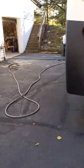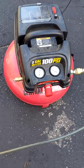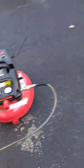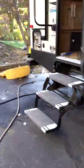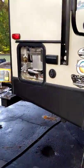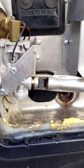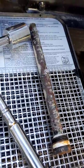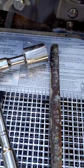I've drained the fresh water tank. I got my air compressor set up here, just a little Harbor Freight three-gallon compressor. I do about 50 pounds or so. And I've got the hot water heater drained — pulled the plug on that. It's all nice and drained. There's the plug with the anode attached. That's two years old, so I've still got plenty of life. It takes a one and a sixteenth inch socket to get that out.